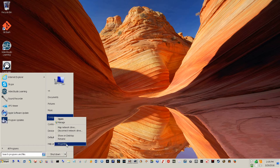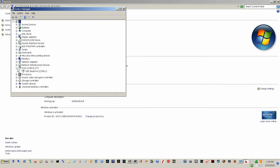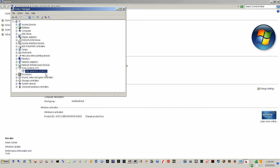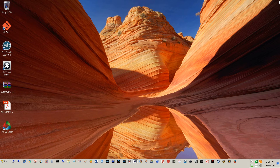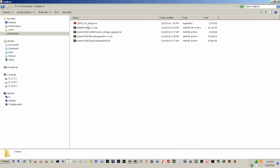Start, right-click on Computer, left-click on Properties, then Device Manager, click the Plus, click on Serial Port, right-click, go to Properties, go to Port Settings — still at 115,200. I can see in the description it's still on COM 11. No errors. The driver version shown is FTDI 2.12.16.0, which is what I saw in that update. That seems to be the correct version from this setup.